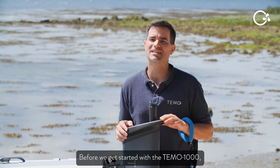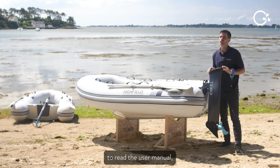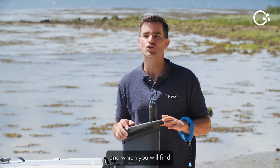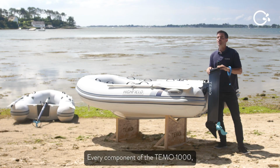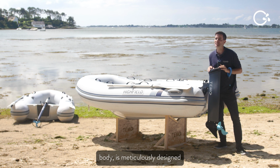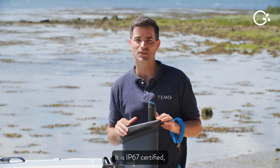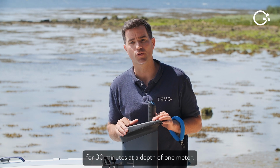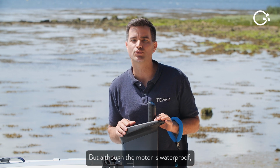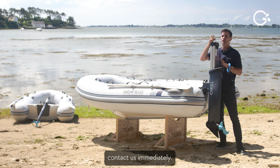Before we get started with the TEMO 1000, let's talk about safety and durability. We strongly advise you to read the user manual, which you can download from our website and which you will find in the description of this video. Every component of the TEMO 1000, from the battery to the motor body, is meticulously designed to withstand the elements. It is IP67 certified, which means it can be submerged for 30 minutes at a depth of 1 meter. But although the motor is waterproof, it doesn't float, so don't go crazy. If the battery is badly damaged, contact us immediately.